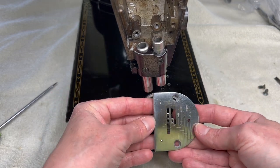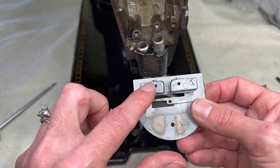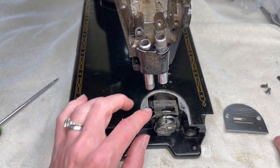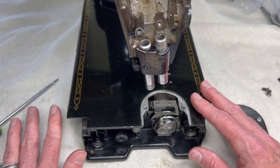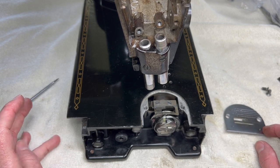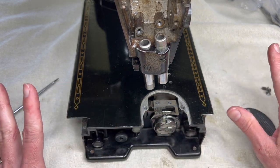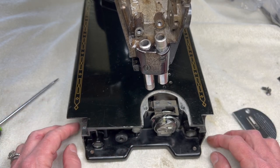When we lift the needle plate up, you can look at it and check out how much damage it has — check the underside. We're going to clean all of this. Normally this isn't what's too super dirty; normally what is super dirty is down in here. This machine I purchased from someone who liked to play around with them a little bit, and I believe they must have cleaned all the lint out, because it was surprisingly clean as a whistle. But don't be surprised if you find a lot of lint and other threads stuck down in here — that happens. That's why you should know how to remove this so you can get to this area. I really like to vacuum it out — I don't recommend blowing air into these areas because all you do is blow lint into other mechanical parts of the machine. You can use tweezers, clean it out, use a little brush, and then just give it a good vacuum and you're good to go.